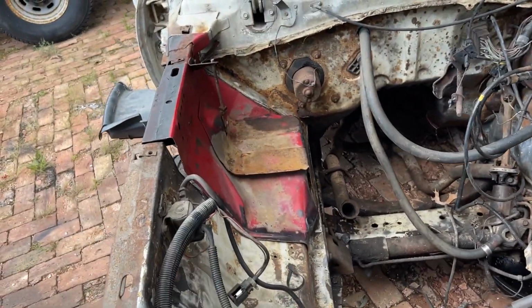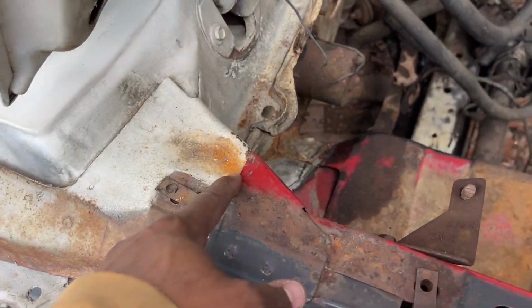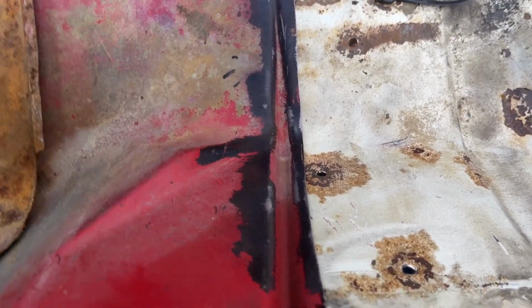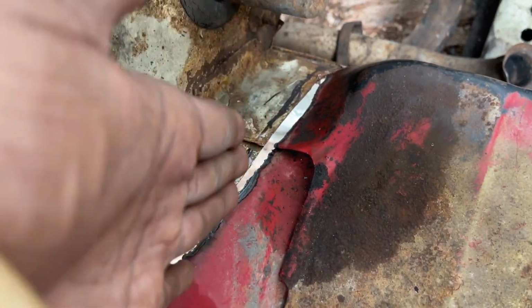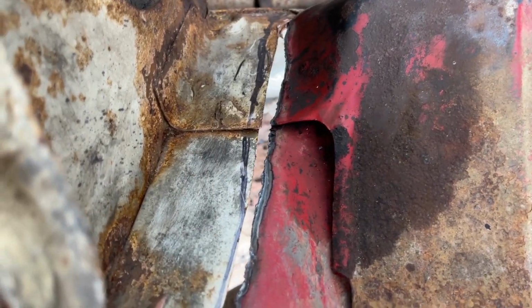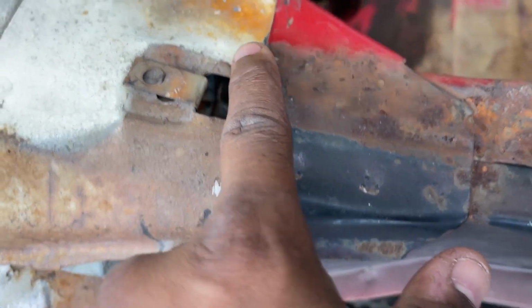Okay guys, we're getting close. I'm hitting here now. And although the plasma cutter don't have a straight edge like the angle grinder or metal cutoff wheel, it does this effortlessly. You know, these ridges, as steady as you can hold your hand, the straighter the cut is gonna be. And I braced myself real good and I'm almost there. I'm just hitting here now.